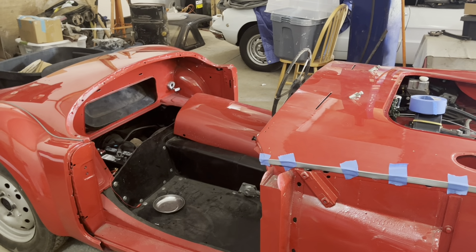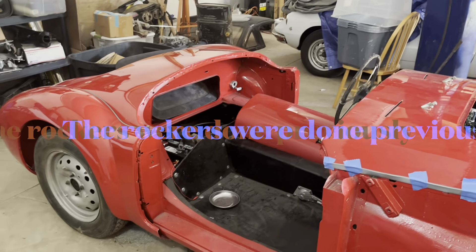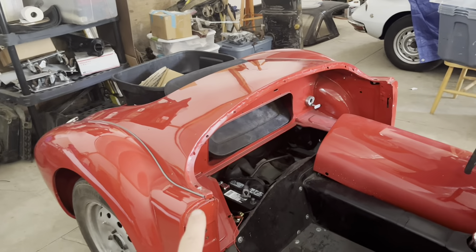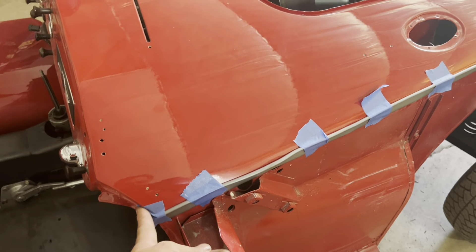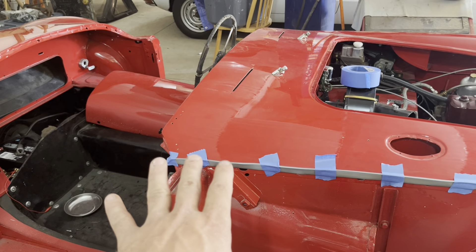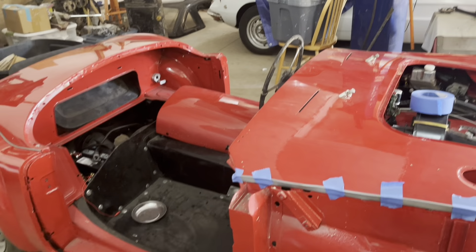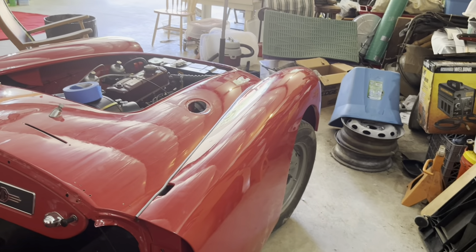It's always suggested to do that before you take it off the chassis, because once you take it off a chassis it's way harder to put the rockers in later on. In this case we didn't take it off the chassis because he didn't want to take it that far. But I know I lined up the top exactly with the rear fender and the front exactly with this, so I know how it was aligned when I was doing the bodywork. I should be able to put it in that same spot and line up the door to the fenders. If you don't know that, you might end up adjusting the door the best you can and then moving the front, rear, or both fenders to get everything sitting the way you want.